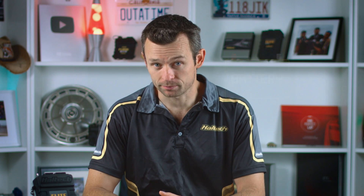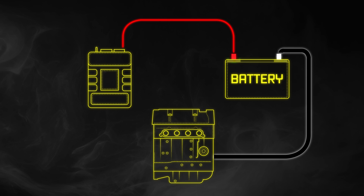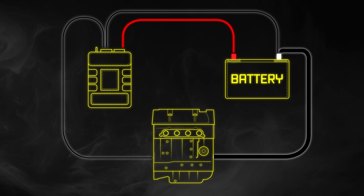Since we're talking about this in the context of ECU grounding, let's look at the voltage from the ECU's perspective and predict what can go wrong due to different voltage drops. In this first example, we've grounded the ECU to the engine but also to the battery. I actually see this quite a bit — I guess it's because people see ground straps on both the battery, block, and chassis and think if one ground is good, two grounds is better. Or perhaps they bought one of those eBay grounding kits and made that extra 15 horsepower that was promised, and now they're in the habit of putting ground lugs on everything and anything.